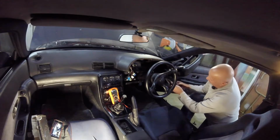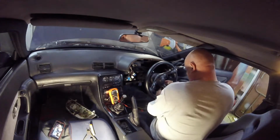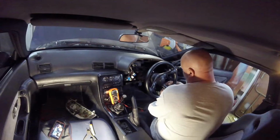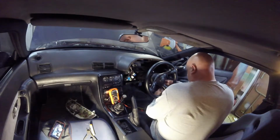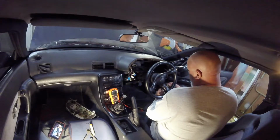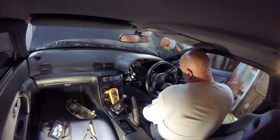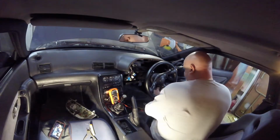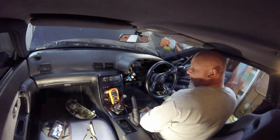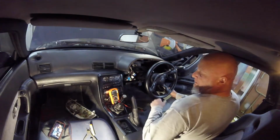So I'm just going to come back to this area back here a little bit and do my splice back there. I ended up going on the white connector that's right near the black one, where I had the red wire. Actually, it's a red with vertical and horizontal blue striping and silver. I ended up going with, on the white connector right next to it, the green with silver, which you'll find when you start metering it out. There's a bunch of choices for ignition power. I just chose that one. I spliced it together, plugged in the cluster, and the dash lights come on with the key now. So I'm going to heat shrink this, and then we'll go on the bench and do the bulbs.